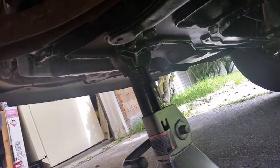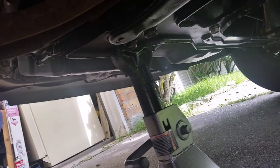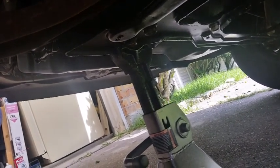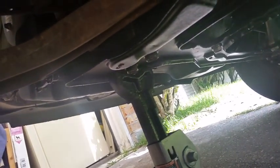We'll get to that next after we put the jack stand in. Place the jack stand between those two body mount bolts for that little flex plate underneath there. It actually is right underneath the main support bracket for the whole front end assembly, which is that aluminum piece right there above that round bar. This is a really good place to put it.